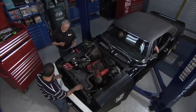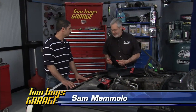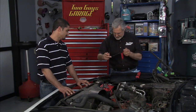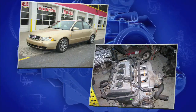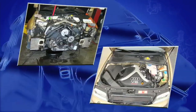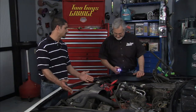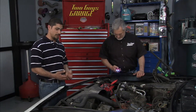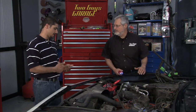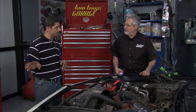Fuller, hop in there — I'm going to need you to operate the key. I put in that neutral safety switch and took out the extension wires we were using. The good news is, you can't put these together wrong — they're keyed. Even I can do this without making smoke. We use these mostly for engine swaps. For instance, we took an Audi — took out a 180-horsepower four-cylinder single-turbo engine and put in a four-year-newer V6 twin-turbo 500-horsepower engine. Now we have to make the room harness match up with the engine harness. When you have different colored wires, you go to the open plugs and start probing each one, turning them on to see what is being lit up — the tail lights, the parking lights, the reverse lights. Then you go on the other end of the harness and see what controls those lights and connect them.